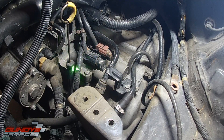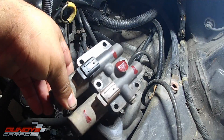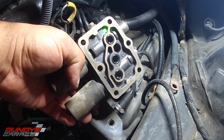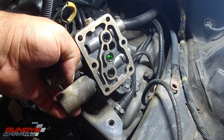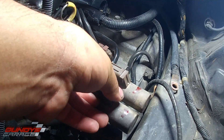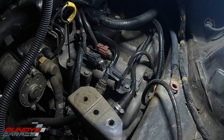There's five 10mm bolts that hold this thing on. It looks like this right here. It has three O-rings that you need to make sure are on there. Also, there are three little pipes that go into where these O-rings sit. So when you place it down, you basically can't slide this in — you have to place it down onto the three metal stems. You'll see them when you get it off. At the end of those stems is a tiny little filter, so make sure those filters are clean as well.